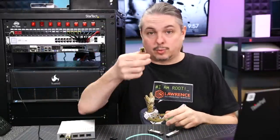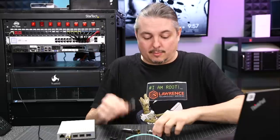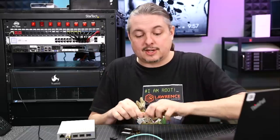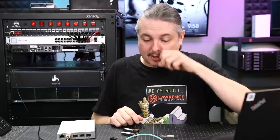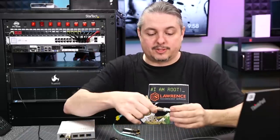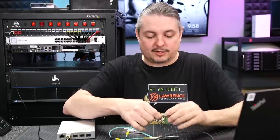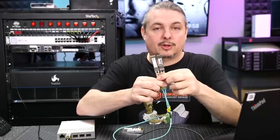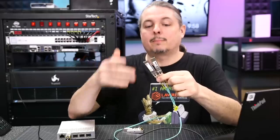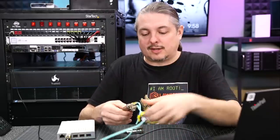I'll leave links to the two switch reviews. These transceivers work perfectly fine in the UniFi — all the optical cables, the 10 gig and 1 gig ones, the 10G Tech ones, and a random one I found in a box all work fine together. I mixed NHR and 10G Tech optical connectors — different brands — and had no problems. They are standard, so they should work. But ideally, if you're building out your network, buy the same brand and save yourself any potential headaches.